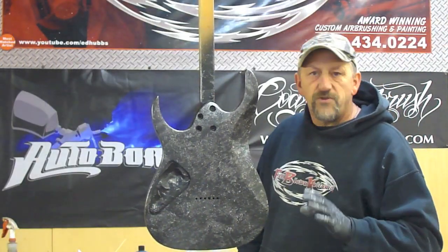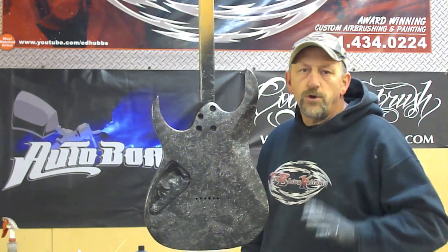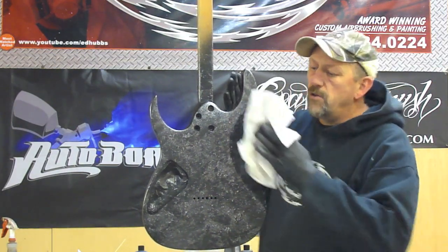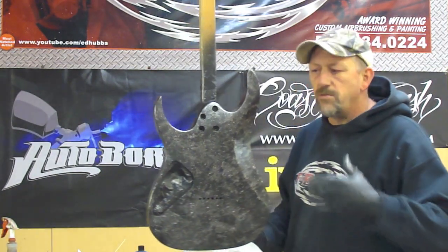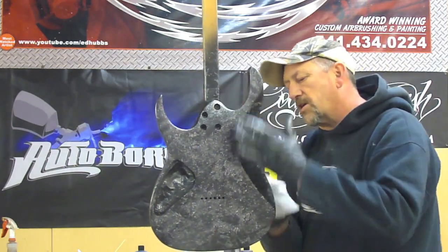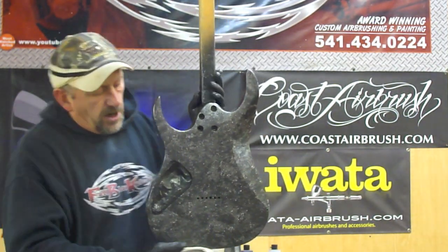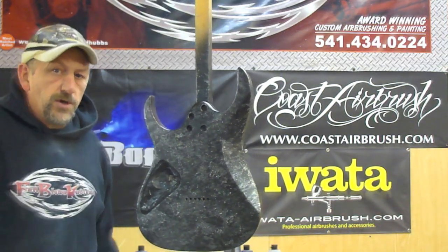It's taken about 35 to 40 minutes to do everything. Before you clear it, take wax and grease remover, spray it on a rag lightly — don't spray it on the surface itself — and wipe over everything. Make sure it's dry first; I like to wait about 15 to 20 minutes. I'm going to throw an inexpensive clear coat on it now, sand that clear in the morning, do my artwork, and then put a high-solids clear on top after that.